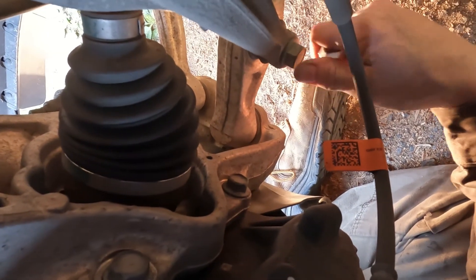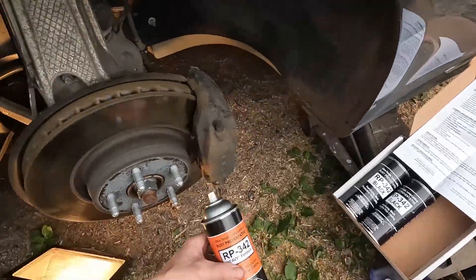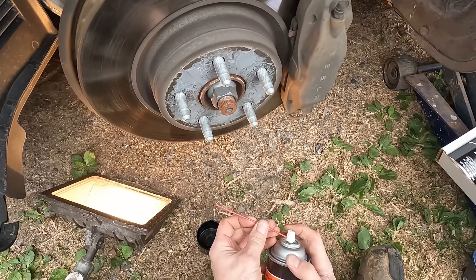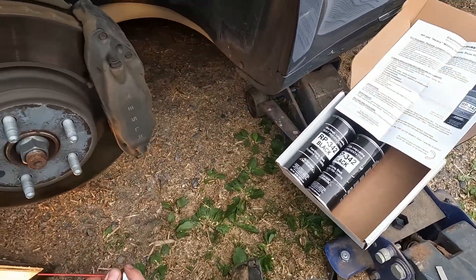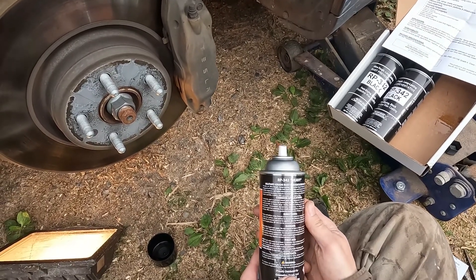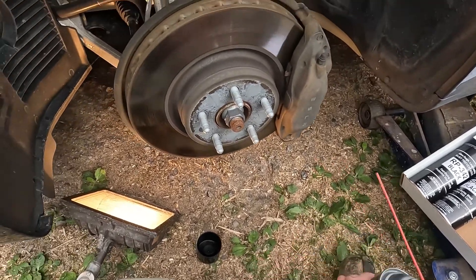So what I'm going to do is hit this stuff up with cosmoline to make it last longer — try to get 300,000 miles out of it. I got cosmoline from Cosmoline Direct. It's basically a wax coating that keeps steel from getting rusted. We're going to hit up all the parts that we know rust, without trying to get any onto the brake pads or rotor. Directions say: shake well, clean and dry, spray evenly, coat, and allow one to two hours for coating to dry. Second coat I'll do next year at this time when taking off the winter tires.